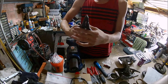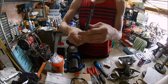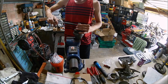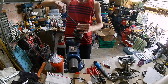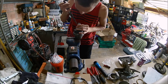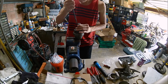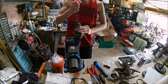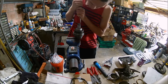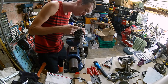I got this tool now — it's for automatic transmission work and it works really well. It has two dimples on each side so it'll hold this perfectly. The beveled edge is still facing up, and we're only going to expand this as much as we have to. There we go — just push it the rest of the way with a screwdriver, and she's in.